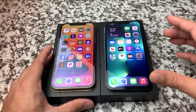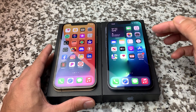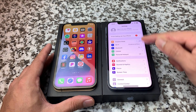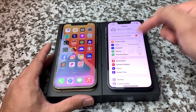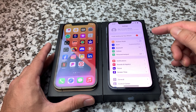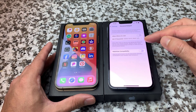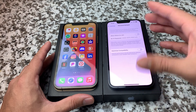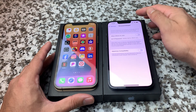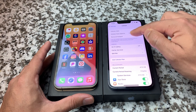Once you know that you have that, go into Settings on your iPhone 13 Pro. Make sure your SIM card is in there and the phone is activated beforehand. You're going to see in Settings there's an option for Personal Hotspot. In the past it used to be just called Hotspot or Cellular Hotspot — it might be slightly different, but look for the word hotspot. You might also see it under the Cellular option where you'll find Personal Hotspot as well.